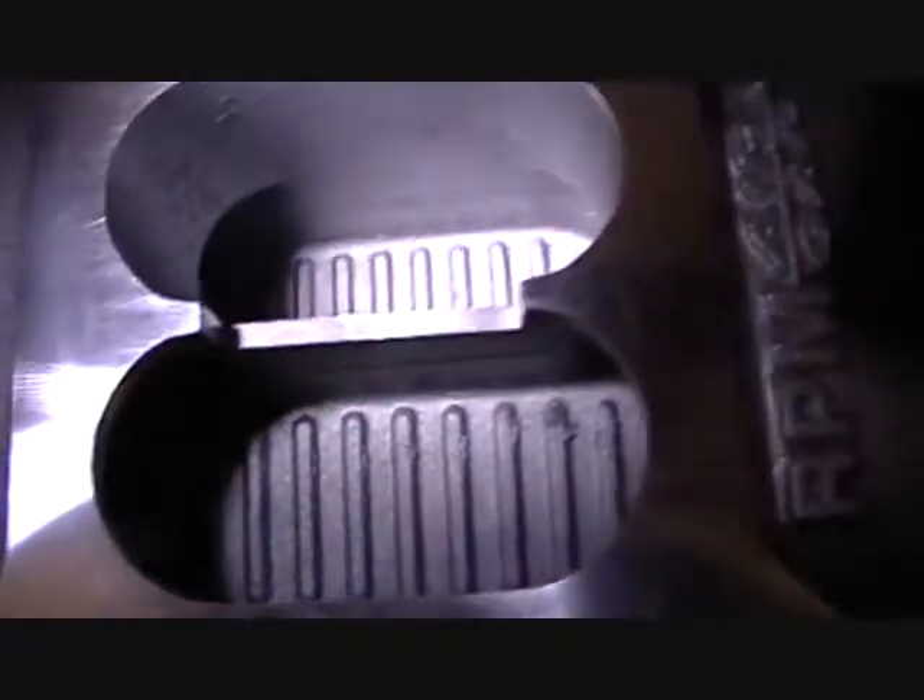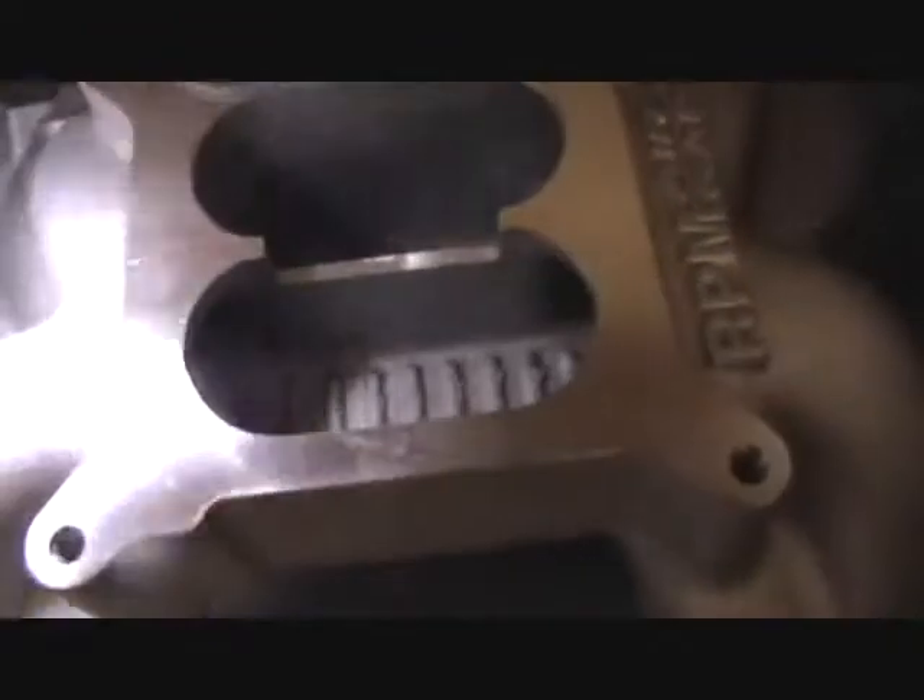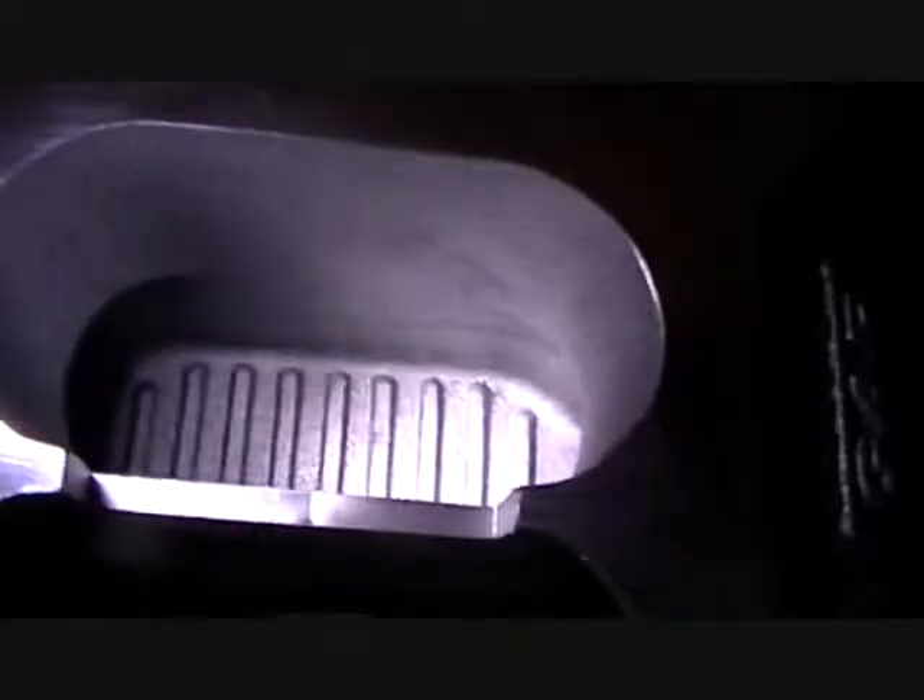Here's inside the intake. I am going to — this has a sharp edge on it, so I'm going to take that sharp edge off and kind of put an edge on there so it's more like a knife blade. And then there's a couple casting marks down in here that I'm going to clean up a bit. I'll take you along for the ride.